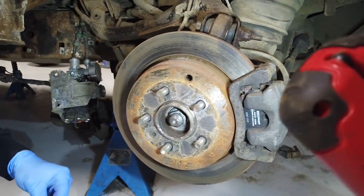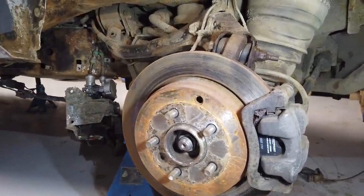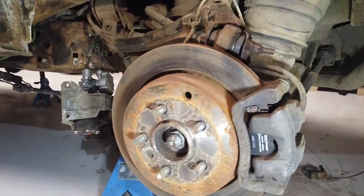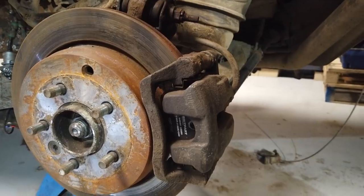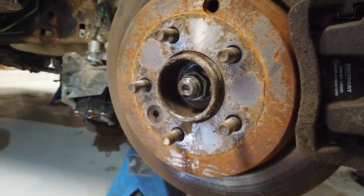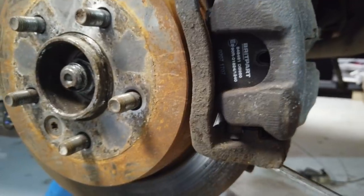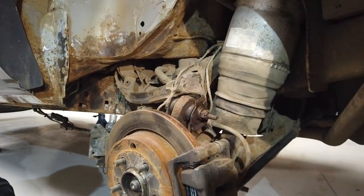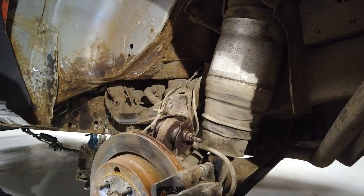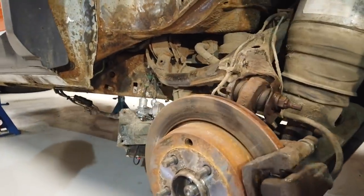Now the trouble is the car's jacked up so the disc is going to spin. We'll have to stick a screwdriver into the vented disc to hold it. I'll hold the screwdriver in the vented disc for you Gary. Give me the flat one - I'm going to put the screwdriver in. I'm sure this isn't standard workshop practice but that'll be all right. We've not used this impact driver before - right, have you got it on undo? Yeah. We like that don't we Gary - right, that's the hub nut off.